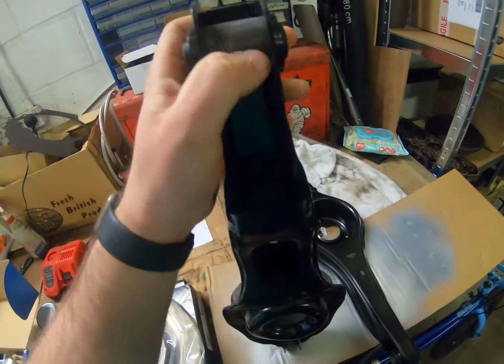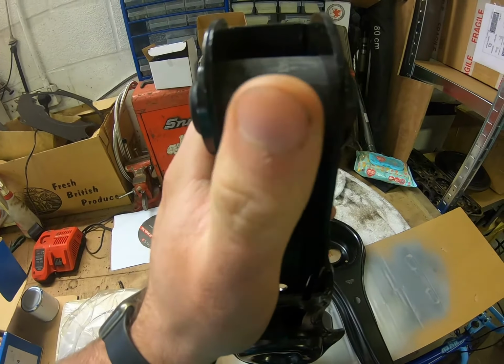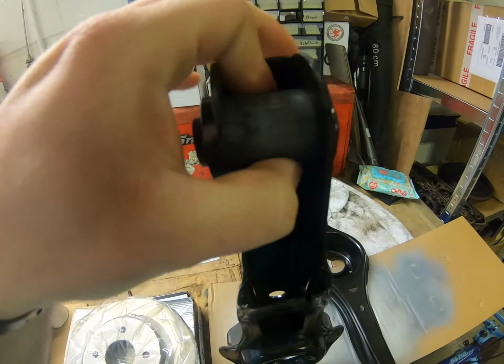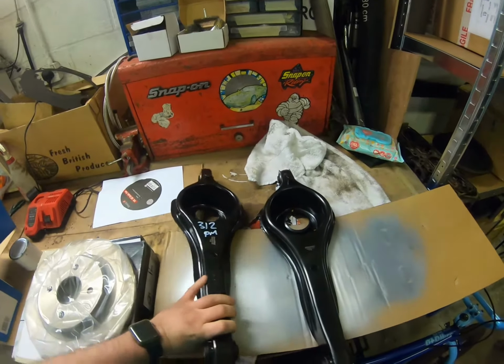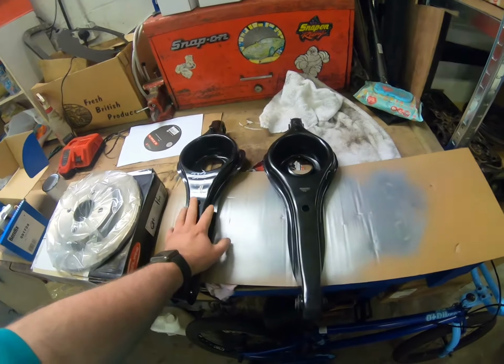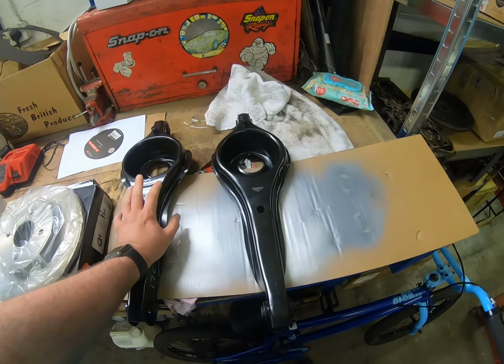is there's a little bush here, and over time that gets really rusty. So as soon as the bolts actually start coming away, because this is rusted to the bolt, it won't release the bolt. So as much as we were trying our hardest to get it out, there was just no way, which is why we had to grind it away. That's why there's no video of that part, because it actually took a lot longer than expected.